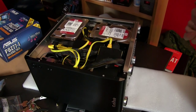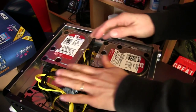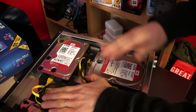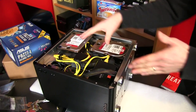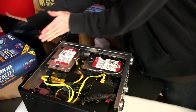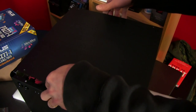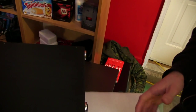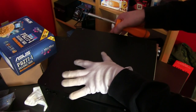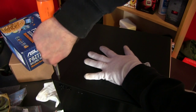Here's the back of this machine. I ended up going with two Samsung 840 Pros - 512 gigs each in RAID 0 - and two Western Digital 3 terabyte hard drives. In theory you could have dual 512 gig SSDs and two 4 terabyte hard drives back here. There was no hope in using the actual mounting points for the SSDs, which is fine because SSDs have no moving parts. We pressed it flat and it looks like it closes.